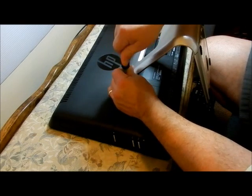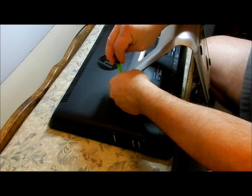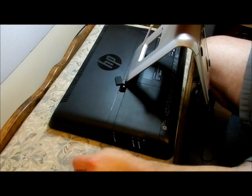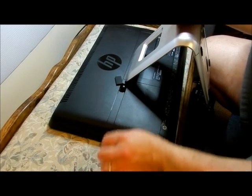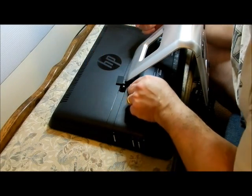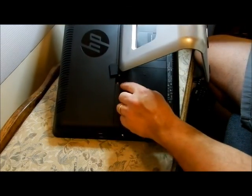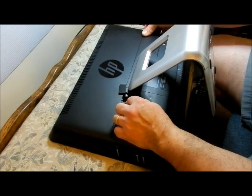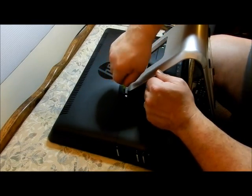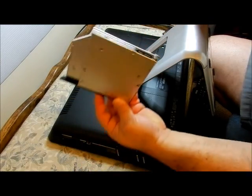This is a kind of odd-looking screw — very long. That's the screw. Now the problem here is there's a little arrow down inside; it's hard to see, but trust me, there's an arrow and a silver thing down there. You're going to stick a screwdriver down there and push. And see, it comes out. And that's your CD-ROM drive. That's where the screw was that went in there.